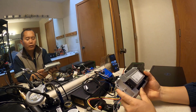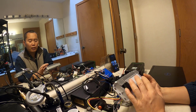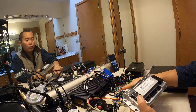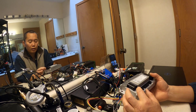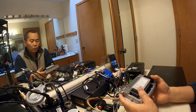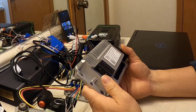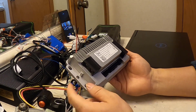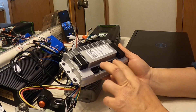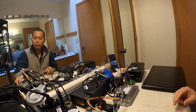The cheaper one is the one I usually use. The thing I like is all the wires just plug in — you plug in the ones you want to use, so you don't have massive wires around. It's a very simple design: you put the battery link here, the phase wires go here, and then plug in the features you need. That makes installation much simpler.